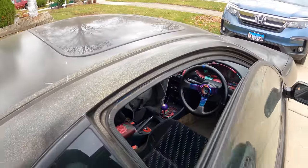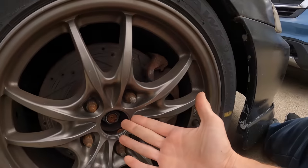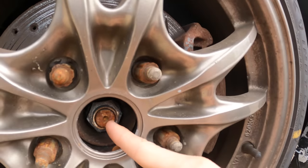This thing needs quite a bit of work, so throughout this video I'll show you the little things that are going on with this car, and a few other major issues — like this one, which I'm actually still stumped on. For some reason the right front axle nut will come loose. I've torqued it to spec, I've staked the nut into the little groove on the axle.